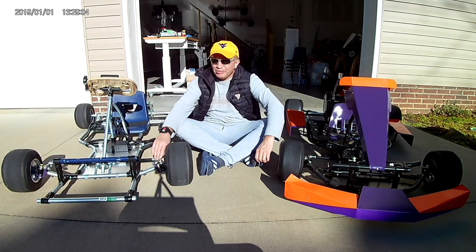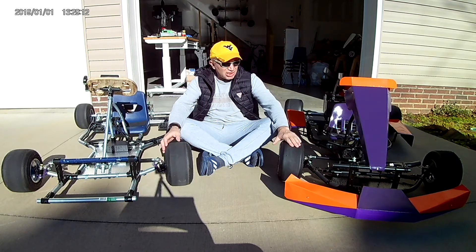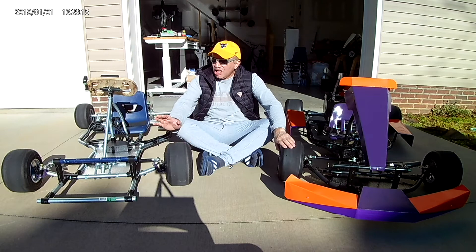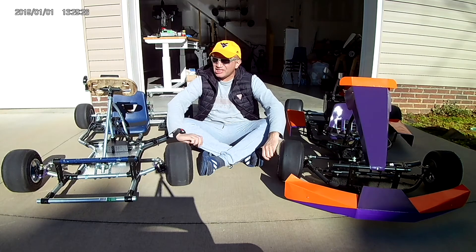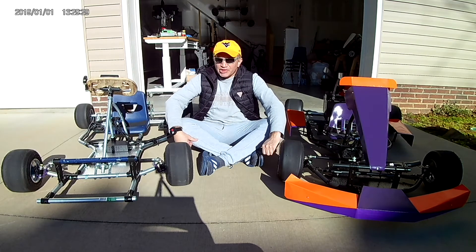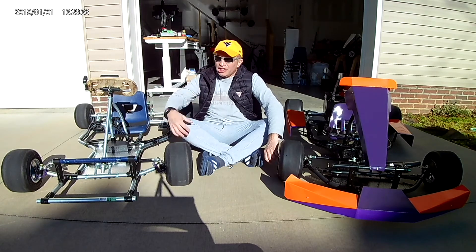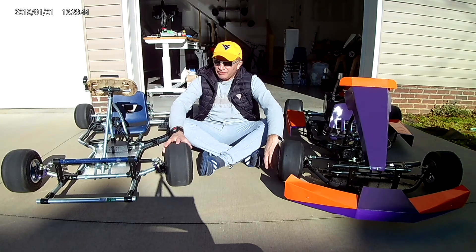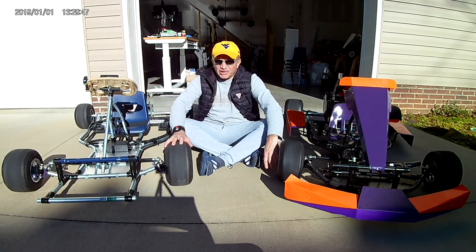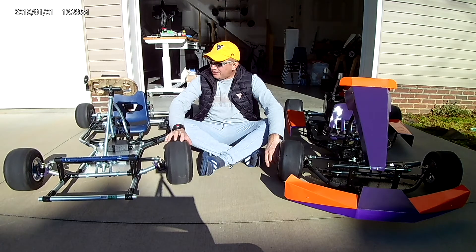On the front end, I'm looking to shorten the turning radius of the cart. This one does approximately 10 to 15 feet, and I believe this one so far — from the way I tested it — is going to do less than 10 feet for sure. I did not push the cart to its limits yet, and I didn't want to be aggressive on the turning on the first test. So right now I'm going to check for loose bolts, the chain on the back, the calibration with the tire, the camber and all those things, to see if everything is still in the same position. Once I finish with that, I'm going to continue testing it and see if it's working the way I want. So far I believe it is — I'm pretty happy with it.